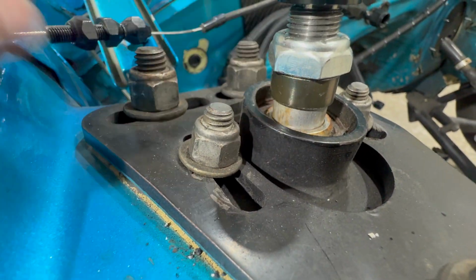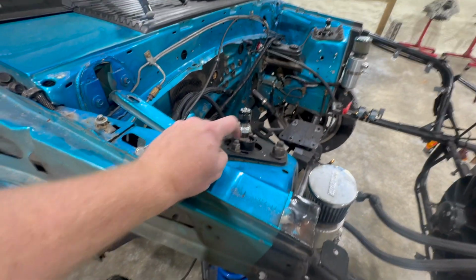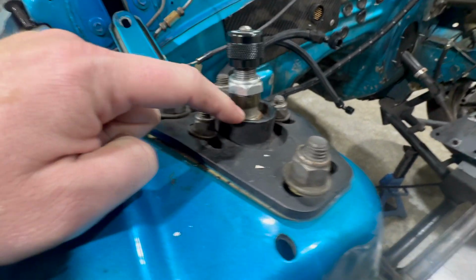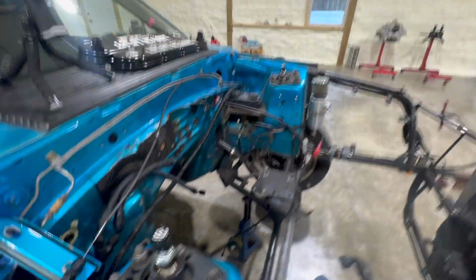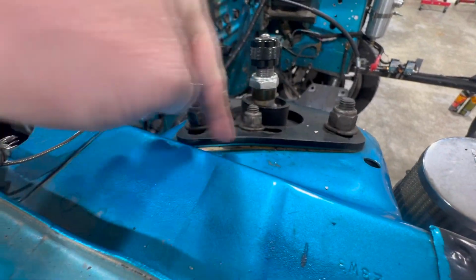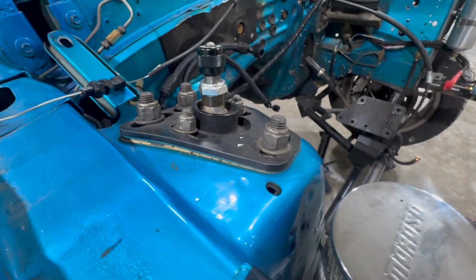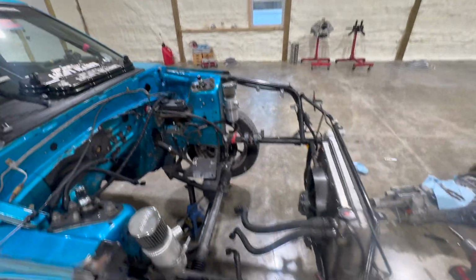That bushing's supposed to be touching that ball. I think I installed them wrong, and now they are right on the bottom side, and I think I just need to add a spacer and fix that. But that caster camber plate's not shaped like it's supposed to be either. It was already slightly like that when I got the car from Nathan, but I think it's worse now. Oops.